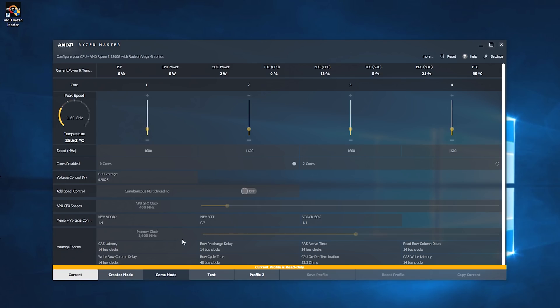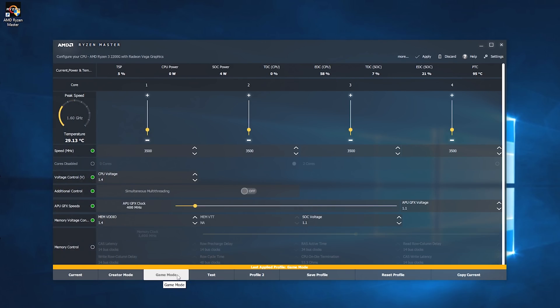Click on the Game Mode tab at the bottom of the window. Alternatively, you can use Profile 1 or 2, and if you want to rename those, just double-click on them. Once you've selected one of these tabs, we can start with either the CPU or GPU overclocking. I suggest finding the maximum stable frequency of one first, then moving on to the other. For the CPU frequency, simply raise it from 3,500 MHz to 3,700 MHz, then run a stress test with a program like Prime95 or Aida64 for about 30 minutes to get a rough idea of stability.